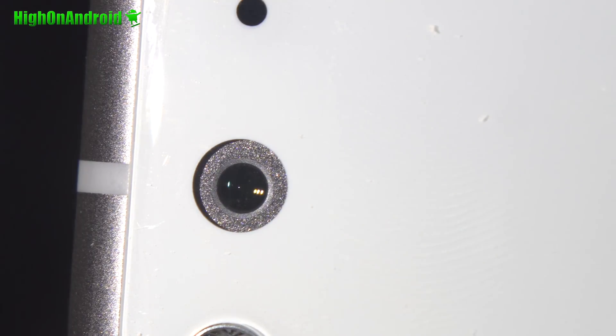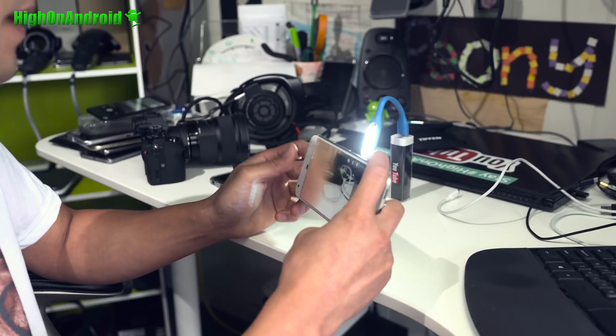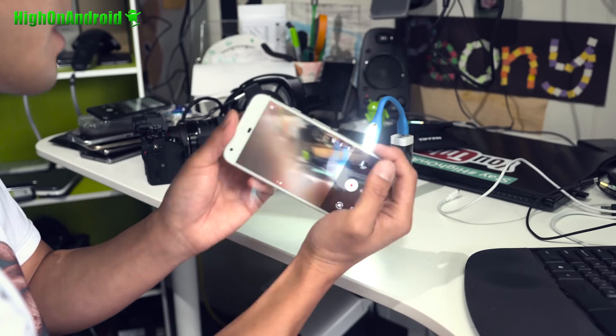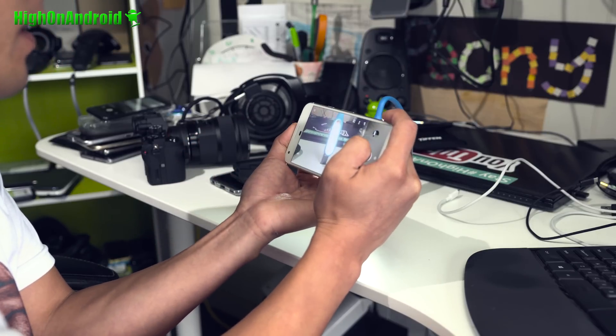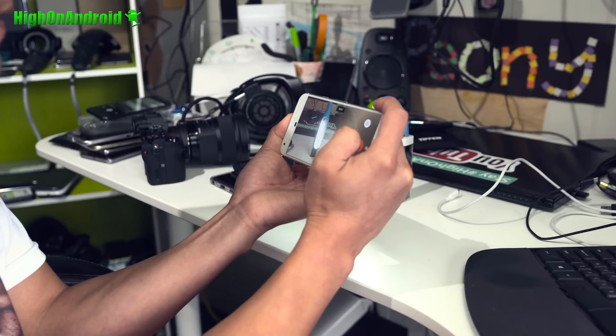A lot of you are telling me that you could fix this by having almost like a lens cap over it. So let me go ahead and do another test with my hand over on one side, sort of covering the halo, and record a video. You'll see that even though my finger is covering over the lens, the halo effect is still happening. So this cannot be fixed with a lens hood — this is under the glass that's causing the problem.